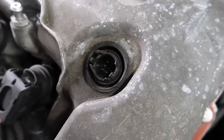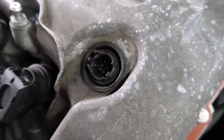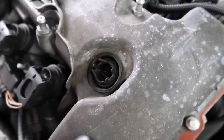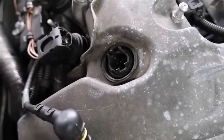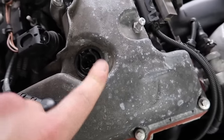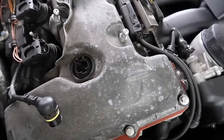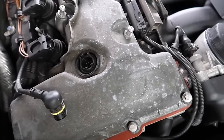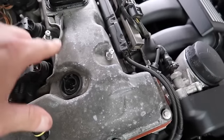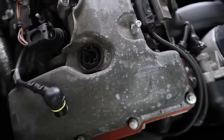When it goes out, a lot of you will experience rough idle, rough running — sometimes your car won't start, sometimes it'll be stalling. When these first came out, BMW actually did a recall for these because they were a common failure item on all the M52 engines, and people were running around like headless chickens not knowing what the actual problem was.